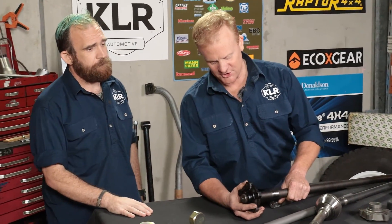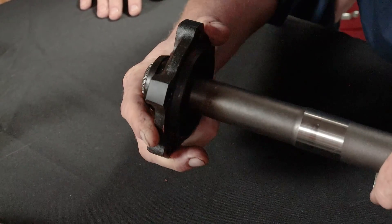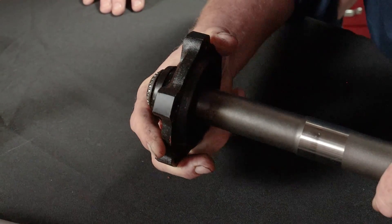Well actually I think you've got a pretty good idea Nathan, but first of all this is the problem: excessive wear, unwanted movement, and they can get to the stage where they strip out. Before we get into too much detail, let's have a quick little history lesson. In the original Range Rover Classic they had one-piece drive flanges and axles. It was a very clever design — there was no spline there, nothing that could wear out.